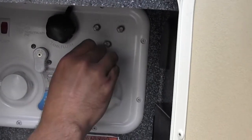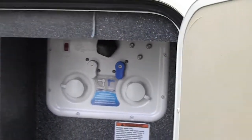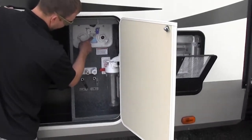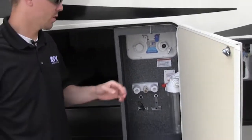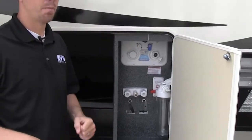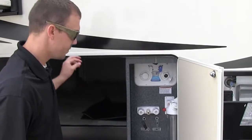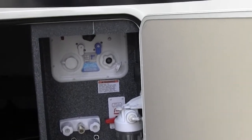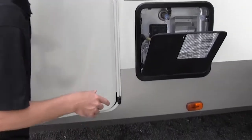Over here, this one down is tank fill — you just screw the water hose into here. So if you go camping somewhere without water hookup, put it down to tank fill like it is now. That'll fill the onboard fresh water tank, and then when you get to wherever you're going, turn the pump on and it pumps the water out of the tank to your taps, toilet, or shower. It is an on-demand pump, so you don't have to turn it on and off as you use it — when it needs pressure, it turns on, and when it's done, it shuts off.